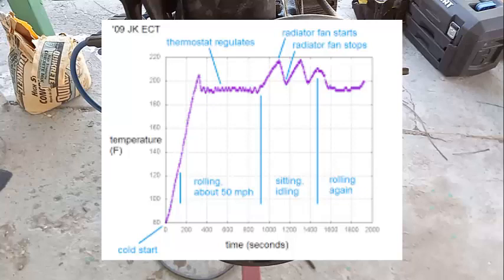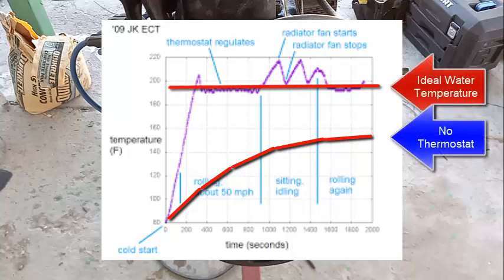Back in the old days, my dad used to take the thermostat out of his cars. If you remove the thermostat the temperature actually drops and the car never overheats, but it never runs at ideal temperature — the engine stays too cold because water is constantly flowing through the radiator and always cooling down. The consequence was that the heater didn't work, so during winter we'd always freeze. Don't remove the thermostat — leave it in.